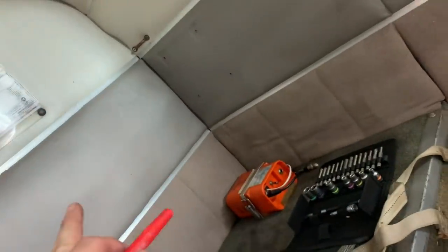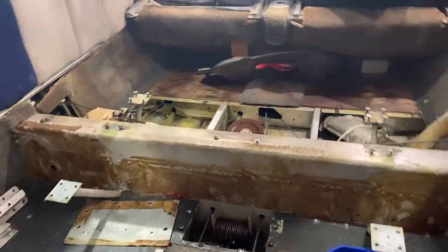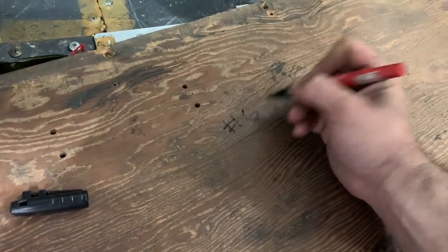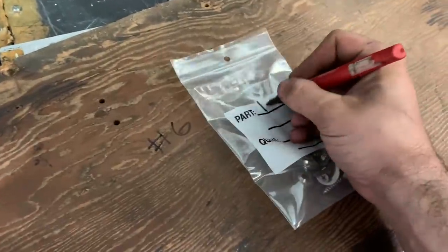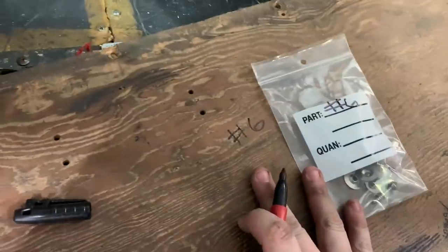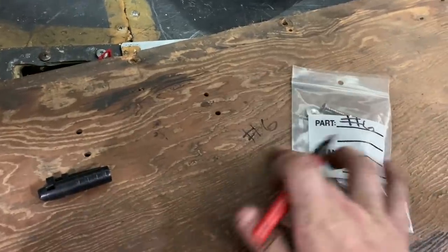I've got it basically stripped. Luckily there are a bunch of panels in the back where you can see all the cables and feel them without removing the interior piece. As far as removing all that wood — what I do is write a number on the wood. The number doesn't matter; all that matters is the screws that go in this board are the same number. Then I'll put them together, and even if they get separated, the numbers go together. Saves you some frustration.